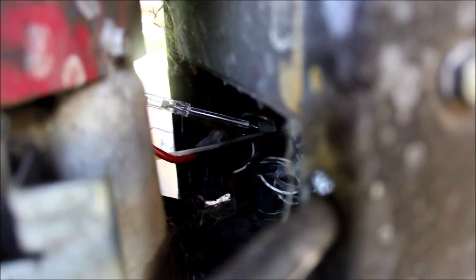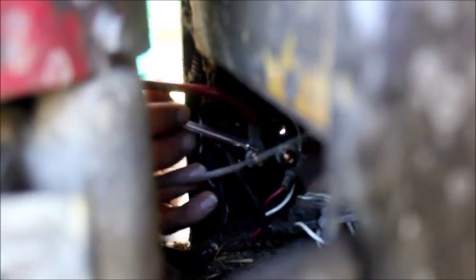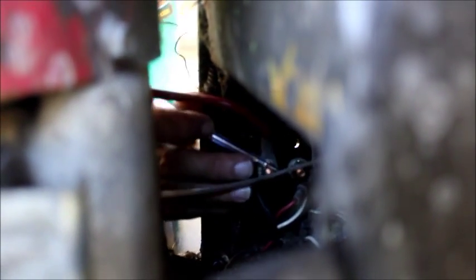What that tells me is that the solenoid is defective. We will replace that. A new starter solenoid is in. We still have power — that's the power lead to the solenoid. One of these wires up here is the ground, one is the power supply from the key, and then this one here, when the solenoid activates, sends power to the starter.